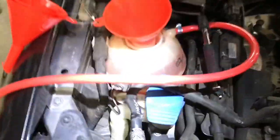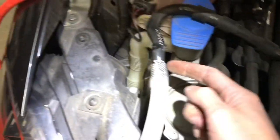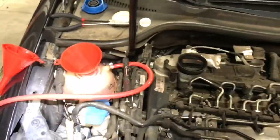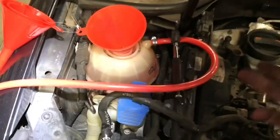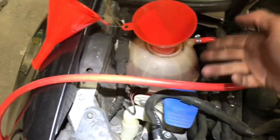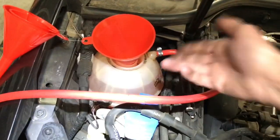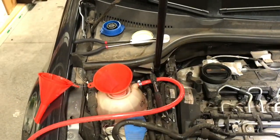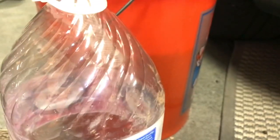To recap: the original return line is disconnected from the reservoir and fed into clear tubing; the return nipple on the coolant tank is blocked; and we have a funnel ready. I did a quick test run and the theory is sound — it pumped out a little bit of old coolant, coming out very slowly, which is good so it won't get away from us. We always want to make sure we're feeding in new coolant as it pumps out and never let the reservoir run dry, to avoid sucking air into the system.